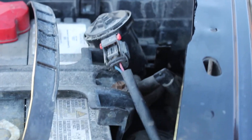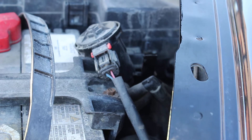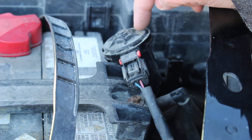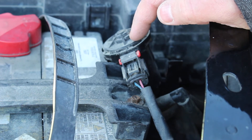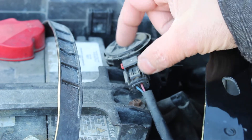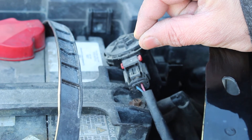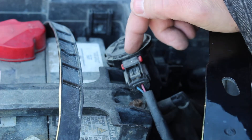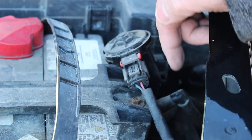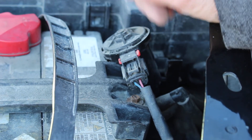When you start your car and let it run for a moment to warm up, one of the lights on the dash needs to go out. One of those lights is your engine light, and one of the circuits it checks is the purge circuit. It will temporarily apply a vacuum to this thing to see if it's working. It'll also check and see if it'll hold vacuum, because this thing's a valve — it's supposed to be able to open, but also to close and seal off. If the system says close but there's still vacuum applied and it leaks, allowing pressure past it, that means it doesn't hold itself closed and it's going to leak air all the time.